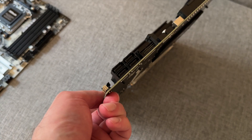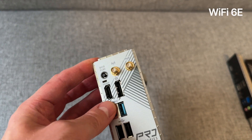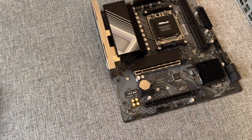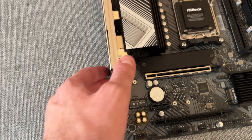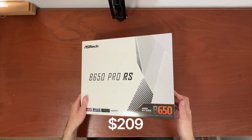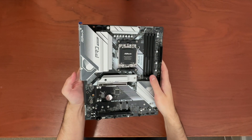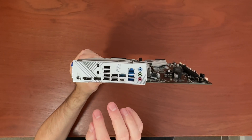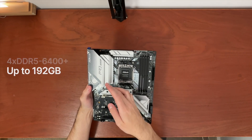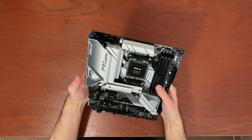There are plenty of storage expansion options to satisfy the needs of an average user. The only downside is that it doesn't come with Wi-Fi pre-installed, but there is a special M.2 slot for a Wi-Fi module and the I/O panel has holes for the antenna. You'll find the Wi-Fi 6 and 6E kits among the links in the description. The more expensive B650 Pro RS at $209 doesn't offer that much more value — the main differences are one additional USB port, two more RAM slots for up to 192GB of memory, and a larger SSD heatsink to keep that Gen 5 SSD cool and performing well.